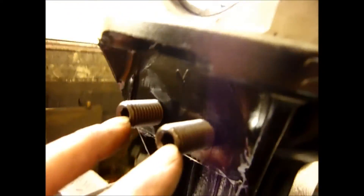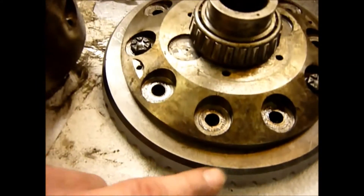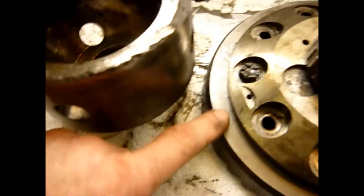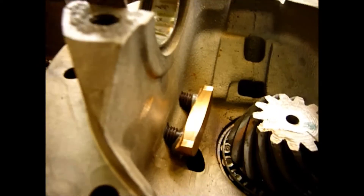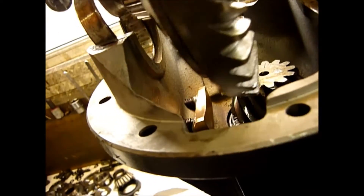Here is one of our peg casings. Here you see the two bolts that are sticking out, and these two bolts are going to have the phosphor bronze pad placed across it. On the outside here are the bolts for adjusting, and here's all the piece that we've TIG welded and ready to go. So this is just a dummy case I'm using, and what happens is that phosphor bronze pad sits here on the bottom of the crown wheel, forcing this crown wheel to stay in mesh with the pinion. Now we have the phosphor bronze pad here — this pad, because it's screwed through the casing, there's about 27mm of metal that these two M16 bolts are screwed into — and then the phosphor bronze pad sits on the end. It can actually float up and down, left and right a little bit, and that then allows us to put the crown wheel back in.